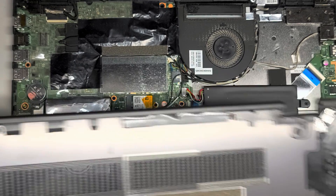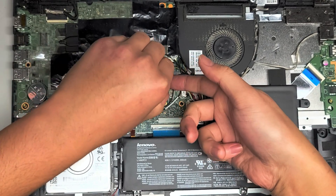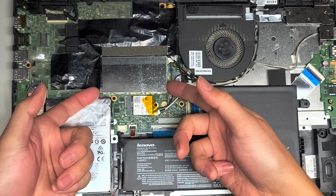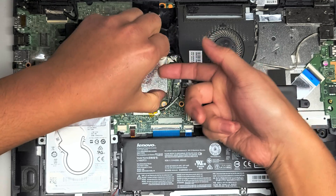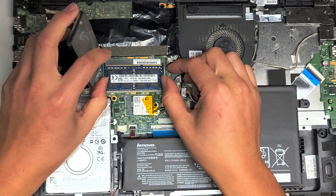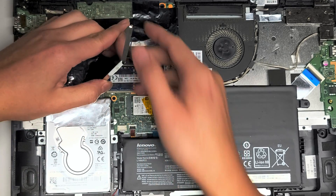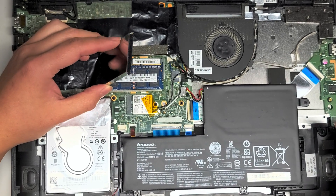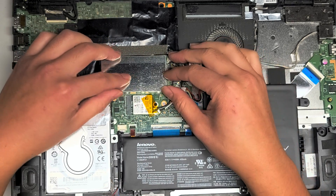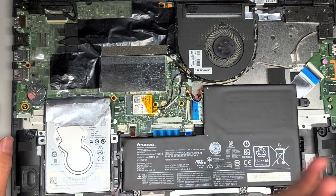I'm on a time crunch so I'm quickly showing this — I have to return this computer to a customer soon. A lot of times if the screen just goes to a black screen... let me pop the RAM up. You just need to pull this metal plate up, get underneath it and pop it up. The RAM is 8GB, PC3-12800S — so this is DDR3 RAM. You can get any size as long as it fits here. If you can find a 16GB stick you can put one in, but I don't think they make that for this. It's DDR3 memory-12800S. If you're upgrading or replacing it, that's what you need. I only see one stick, so that's all there is. If there's a second stick, it's most likely soldered to the board.